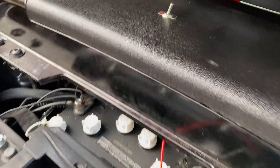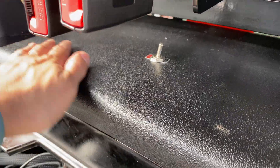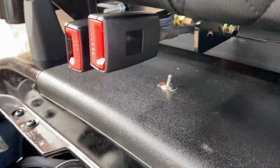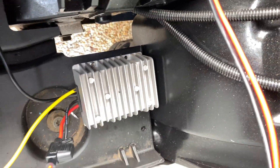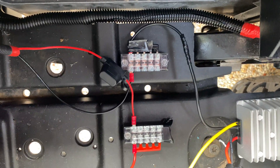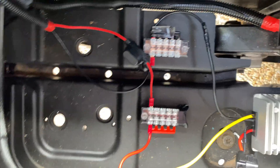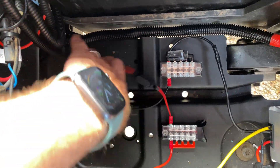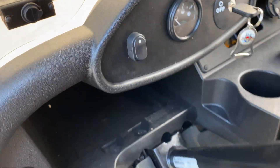I'm back — I've cleaned everything up. I drilled a hole for this switch underneath here because I didn't want to go through the painted body. I tie-wrapped everything up and have a bundle of extra cable here pretty neatly. On my bus bar I put tape over the red side because that red kind of confuses me. This is the headlight — my first 12 volt accessory — and you can see the headlight switch is off.